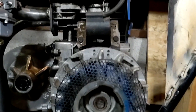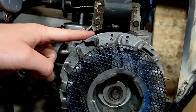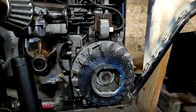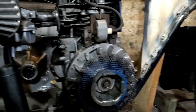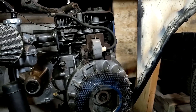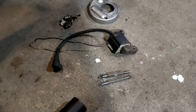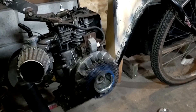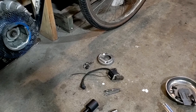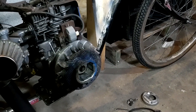So I got the coil on and the flywheel on, and it would appear as though the flywheel is not exactly the same size. Actually, bit of an update — it was not the flywheel that was different, it was the ignition coil. This one is gapped fine, however I still need to use this new ignition coil in order to solve my no-spark issue. So I'm going to have to modify it to fit, or get one that's meant for a horizontal shaft engine and install it on here.